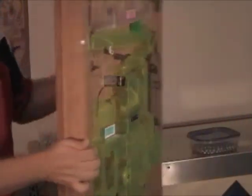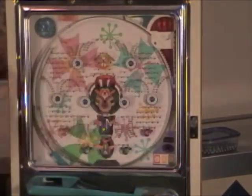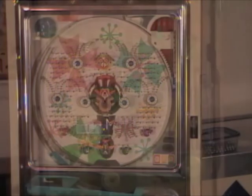Looking at it from the front, you have two red lenses here. Only one will light up and there will also be a light in the center. On some Sankyo machines there's a switch here — when you have balls in the tray they activate that switch and turn off the light. Whenever the machine runs out of balls, the light comes on and stays on until you refill it.